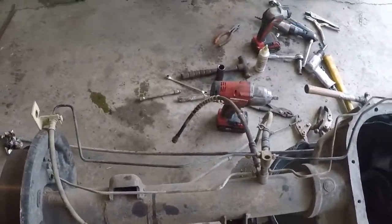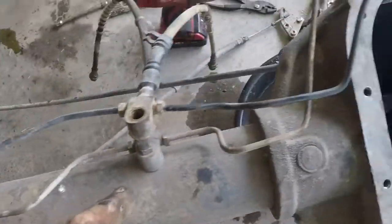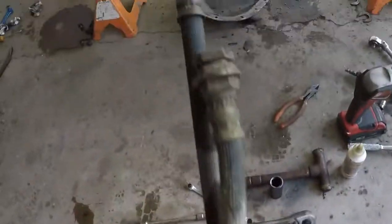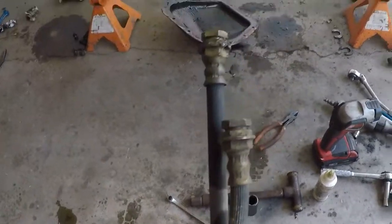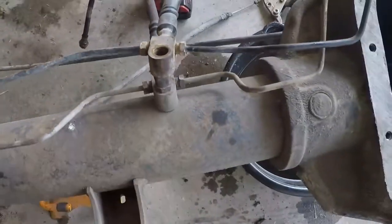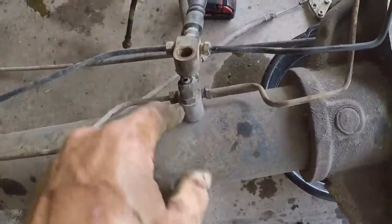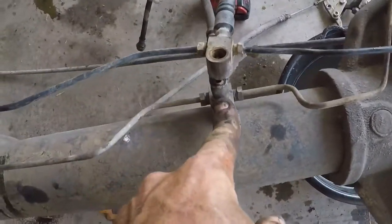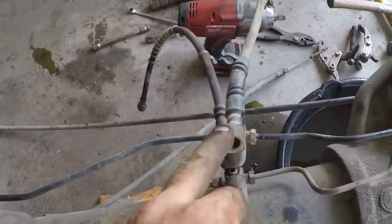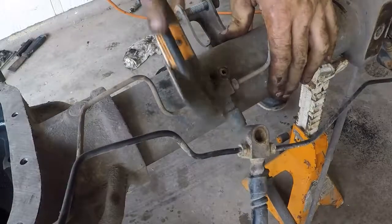Looking at the brake lines — obviously I've got to use these brake lines for the disc brakes. The hose that actually goes up to the frame, the one from my truck is a bit longer including the vent here. So I'm going to pop these lines off, take this, use the vent from my '97 which had rubber hose on it. Then take these lines off of this block and reinstall them on that rear end. I'm running out of wire brushes.